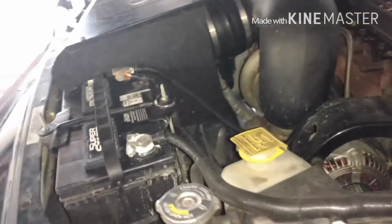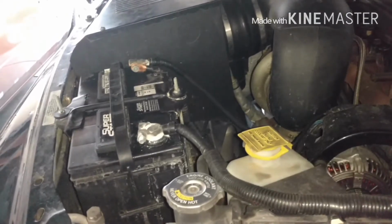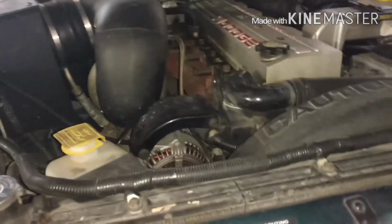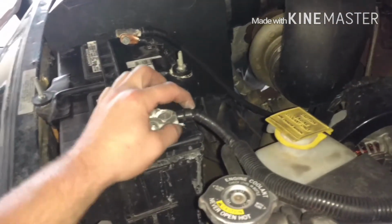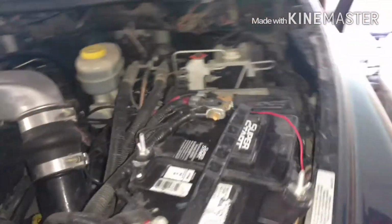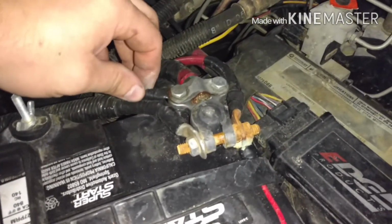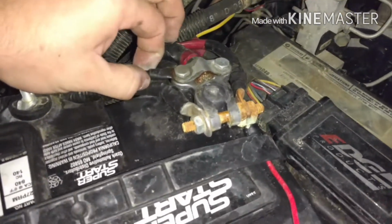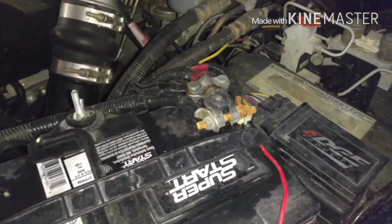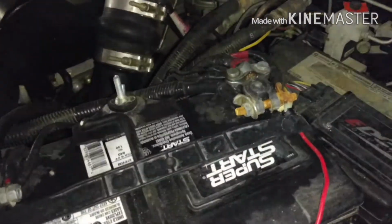And it's pretty simple. I think it took me and another buddy maybe just a couple hours to do all of it, and I soldered in the battery connectors, so there are good connections, other than this one here, because I had to run so many extra secondary wires. And this one, normal parts stores don't have 2/0 battery connector sizes. That was the other thing.